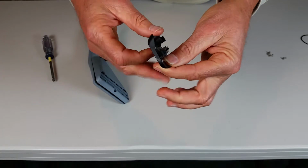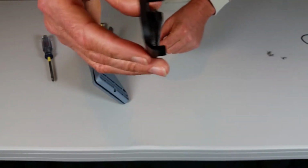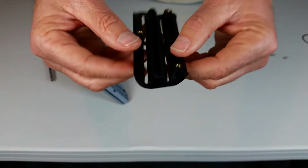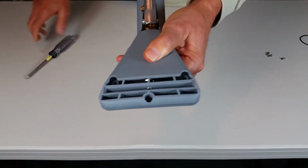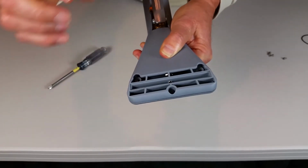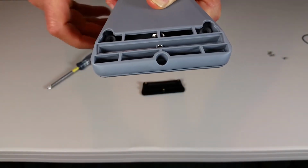Now, once you get it on there, you want to sight down this line right here and see that your O-ring is not twisted. It's straight. And again, it's 1/4 of the way down the tapered edge there. Now it's ready to replace onto the ShearDry, because when we do replace it, that O-ring is going to seat into this square channel that you see right here. It'll actually expand into that channel to create a watertight seal. As you can see there, it's a square channel that it's going to fit into.